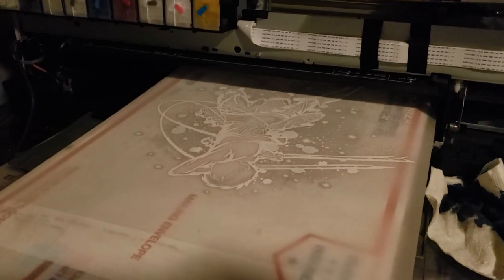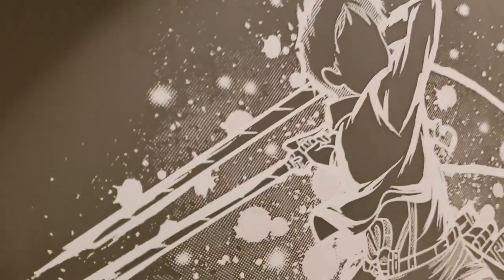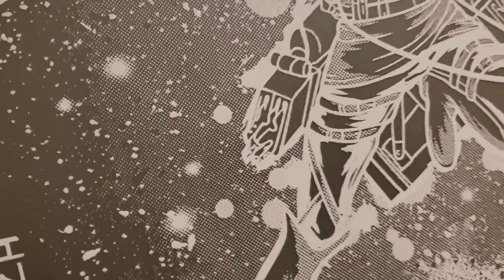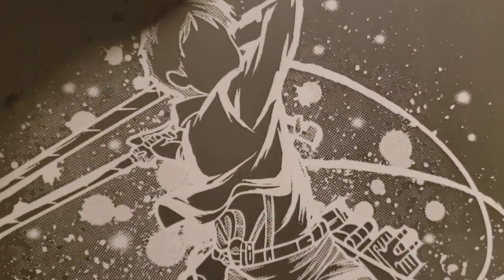It's coming out right now — just finished up. Another thing I did with this image: I deleted the black from it since it's going on a black shirt, so there's no point printing black. That also gives you a much better feel on the shirt. Take a look at the back — you get a real good idea. If I hadn't half-toned it, the entire back would have been solid, and it honestly would have felt pretty bad. You actually can't print smoke gradients with DTF, but if you half-tone it, you can pull it off.